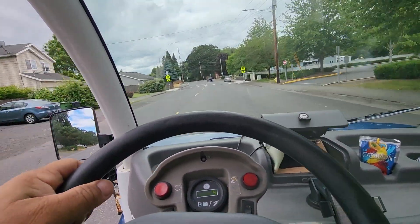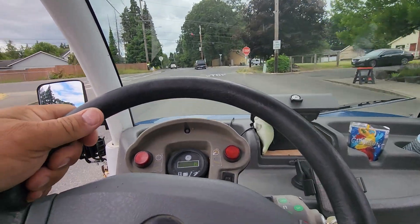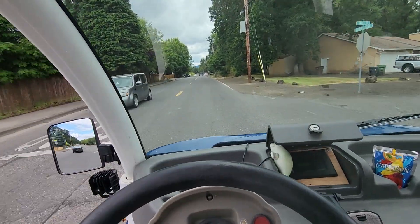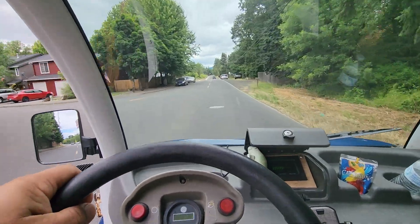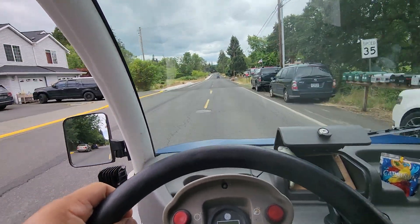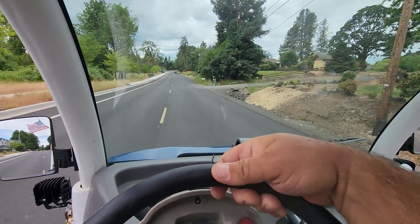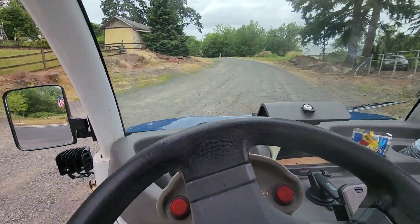I don't let it go below 67 volts. The GEM car controller will cut you off at 66 volts. Even though the LiFePO4 could actually go lower than that, you won't be able to with the GEM car controller. I think 86.7 volts is the maximum you can charge the battery, and the GEM car controller won't give you an over-voltage alarm until around 88 volts. So you're still good even if you fully charge that 24S pack.